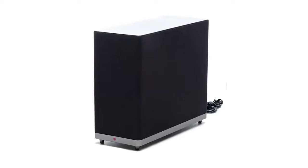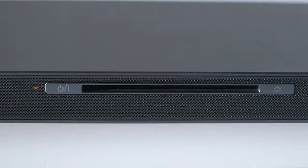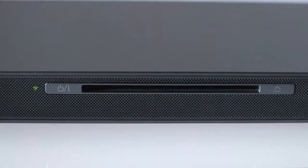The 540 also comes with a separate wireless subwoofer, which we recommend you park about six inches from the wall or in a corner. The setup here couldn't be easier. With your sound plate powered on, just plug the subwoofer into a power outlet, wait a few seconds, and this little red light near the bottom will turn to green, indicating a successful link to the sound plate. That's all there is to it.